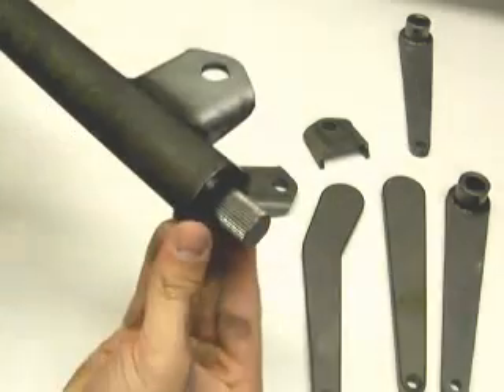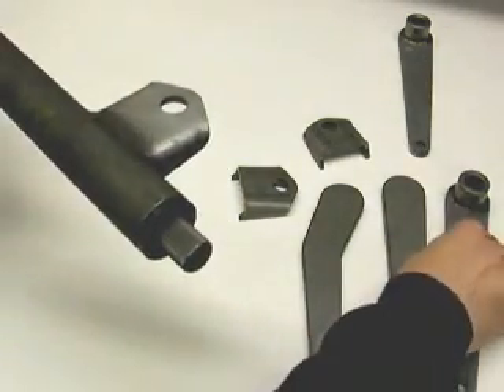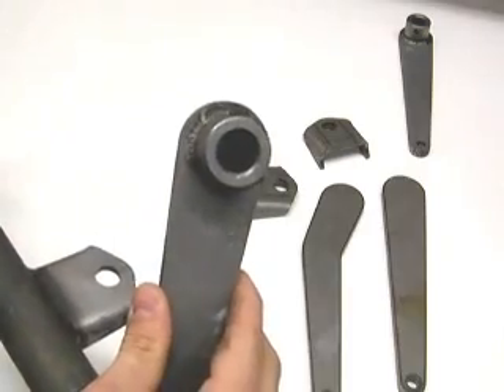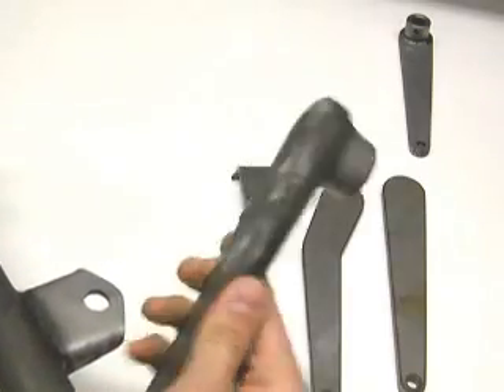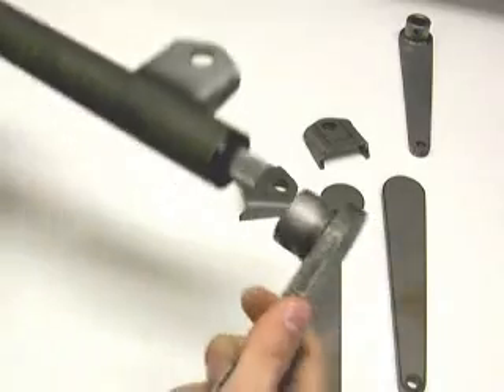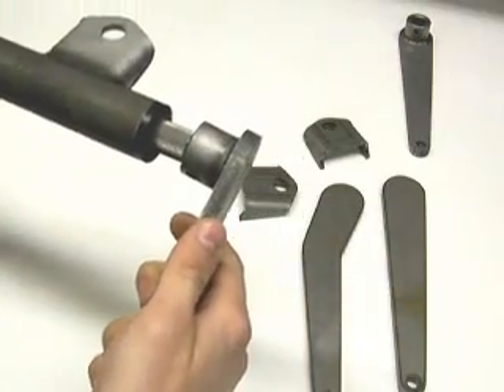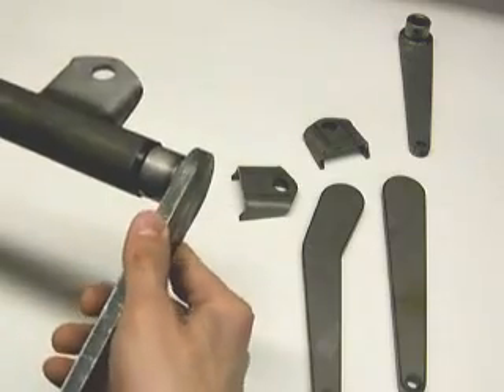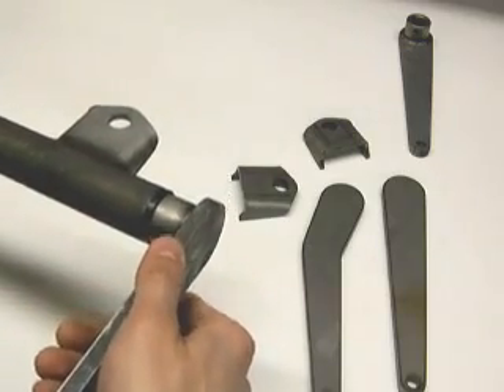The spline will stick out a little bit so that once you weld the coupler — which is splined inside — to the sway bar arm, it will slip over the splines and that's what twists the bar. So you can actually preload it if you want to.